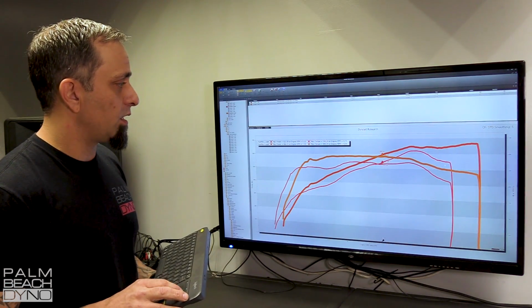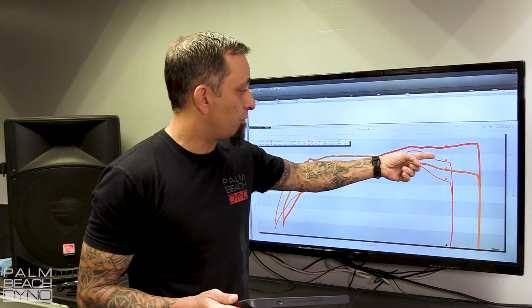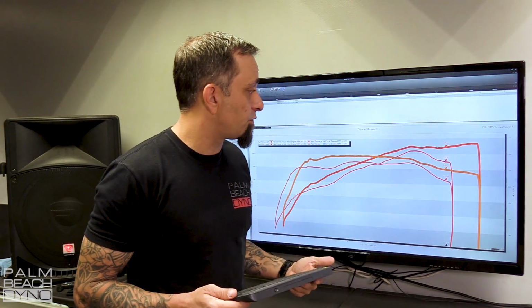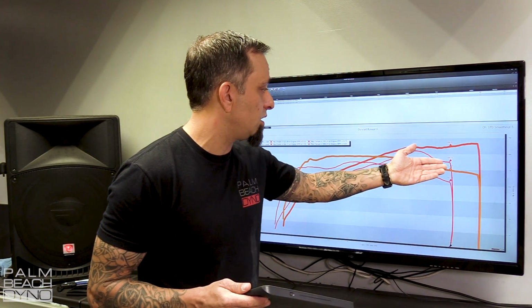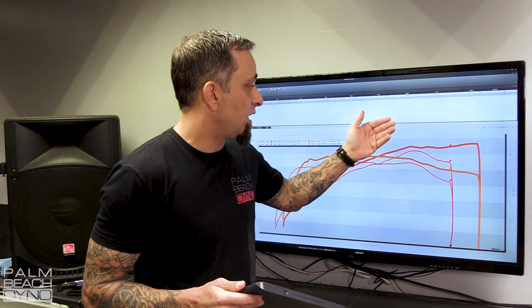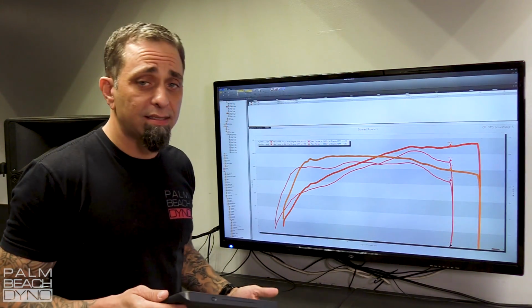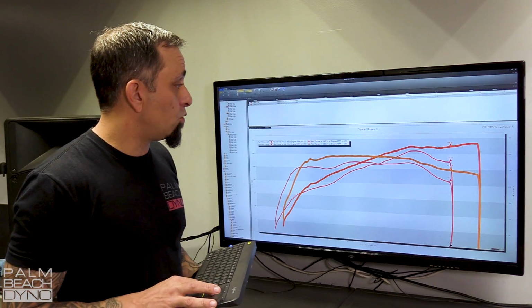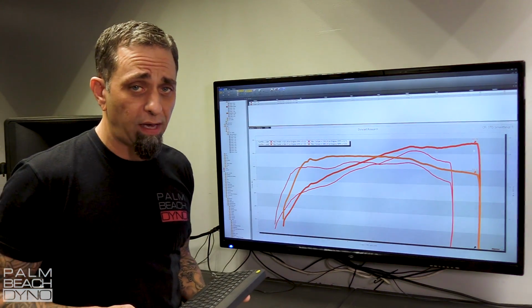And then up here at the spot where we can measure peak horsepower gains, it went from 551 to 643, and that's being actually generous to the other tune. It's actually here where it's 548 and 646, so almost 100 horsepower at 6800 RPM, and even more importantly, we rev it out to 7500 RPM where we continue to gain power.